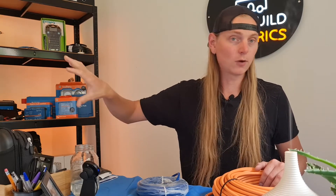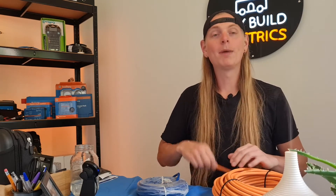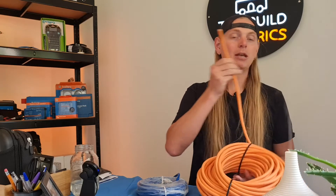If you have any 230-volt electrics in your vehicle, then from your shore power AC inlet point on the side of your van — whether that's on the side, under the bonnet, or on the skirt of your van — the required cable gauge from your shore power inlet up to your consumer unit, whether you've got an inverter, an inverter-charger such as the Multiplus, or just a shore-power-only consumer unit, must be a 2.5 millimetre gauge cable.